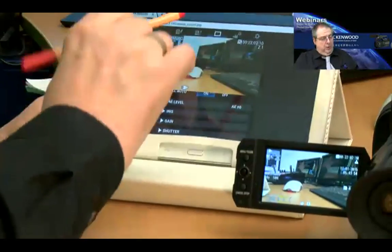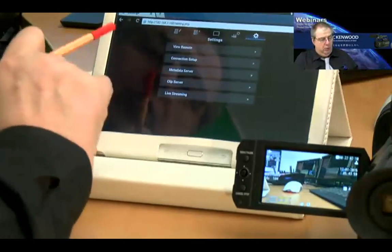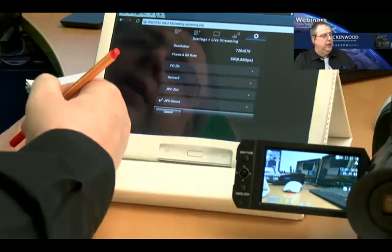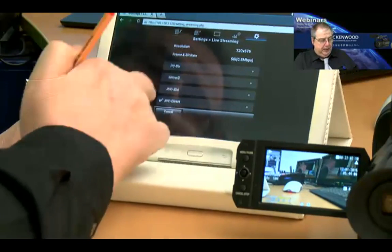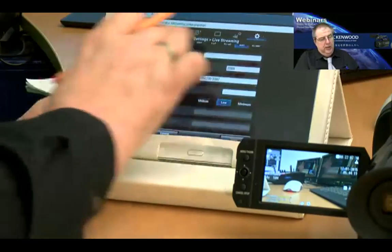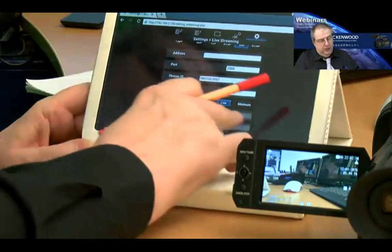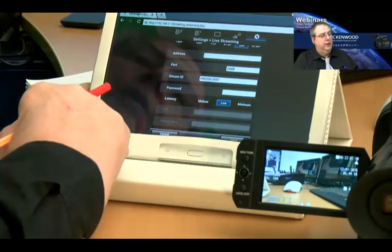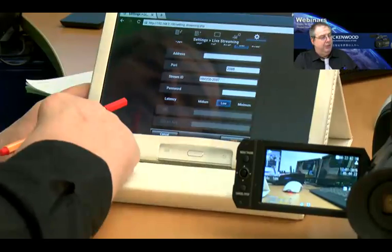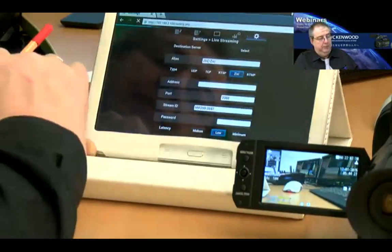But there's more. When we click here, we have the basic settings of the camcorder, especially for live streaming. If you remember the key address for the RTMP, for example, I select any area which I want, and I can do my comfortable IP address setting here. For example, if I want a URL for the RTMP, I simply drag and drop it into that menu, and you have your camera set up for the live streaming addresses. Very easy to do the setup.